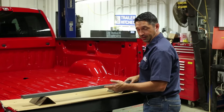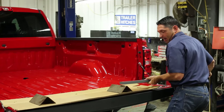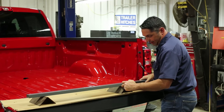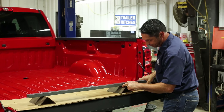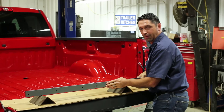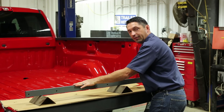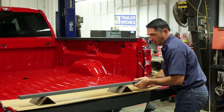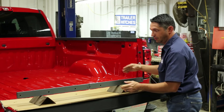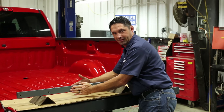When it comes time to install these larger cross members, when you slide this in over the tops of the vehicle frame, there's usually a thick layer of undercoating on the tops of the frame rails that's going to leave a smear of undercoating on one side of the bar. You don't want that undercoating between the cross member and the intersection, so place the bar in a way that when you tilt it into the up position, you're tilting it from a direction where the undercoating will be on the opposite side of the intersection.